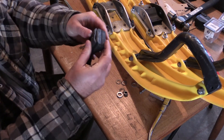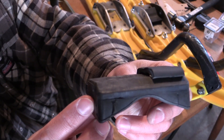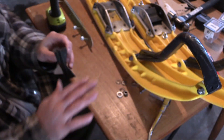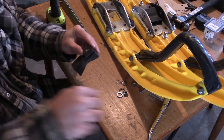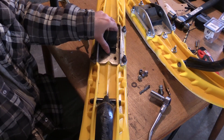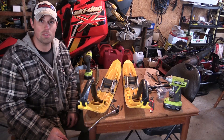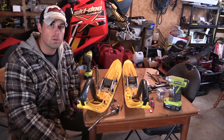There you go — isn't that beautiful? That'll give a little extra pressure on the back of my ski, so the next time I put my carbides on I'm not going to have to worry about busting out the front of them. It also gives you a little more flotation — the angle of your ski helps with turning. From what I've read, it makes turning a lot easier since you're not digging and fighting with your handlebars. Once you've got it, remember it goes in the back. Drop it back in there. Congratulations, you just shimmed a ski! Go enjoy your sled — you should notice that your steering turns a lot easier, you float up on snow a little better, and your carbides are wearing out a lot smoother. Thanks for watching Bogey Wheels.